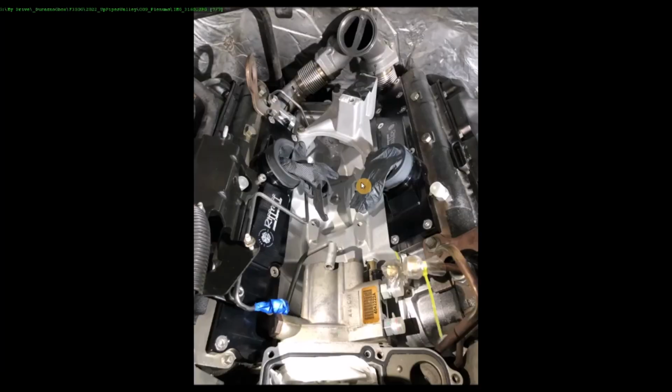And here's a look ahead. Some of the other video clips I'll put in, but see here the up pipes are installed, pedestals installed, the HPOP's installed, and the passenger side fuel line is installed. And of course, the valve cover gaskets are installed. Yeah, a lot of progress at that point. Still have to put the reservoir in and the new filter and gasket.